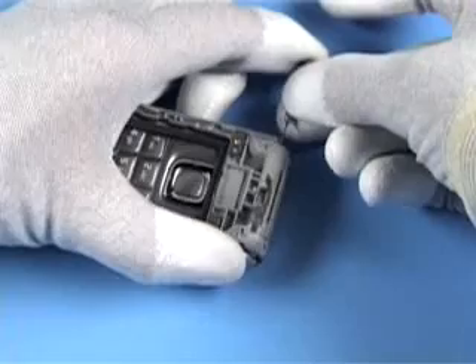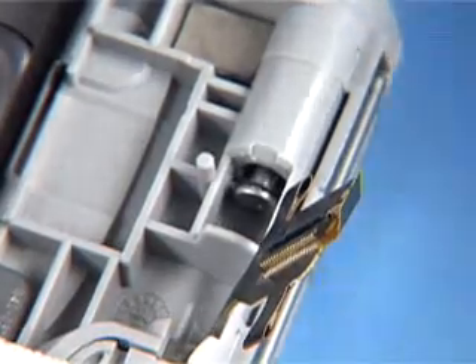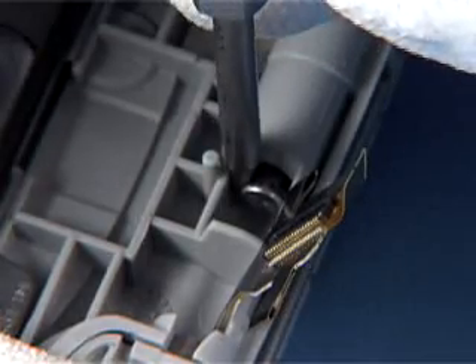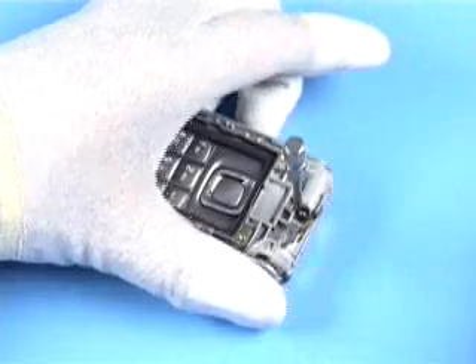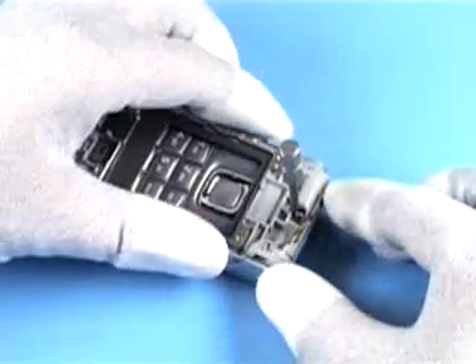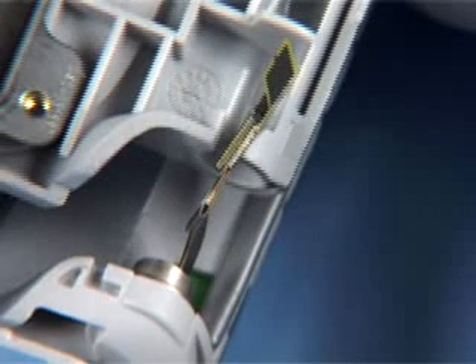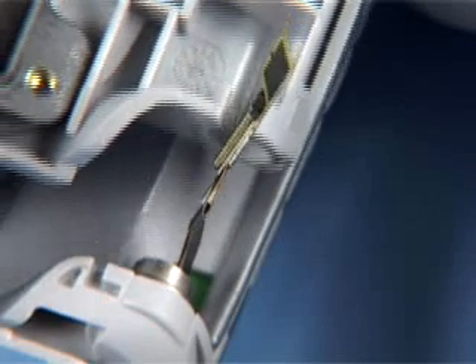Note that the SS-6 is very delicate and can be damaged easily. Now lock the hinge with a Torx bit size 6 or similar. The cover upper assembly can now be removed easily — mind the flex foil. The hinge can be pulled out after expanding the spring carefully if needed.